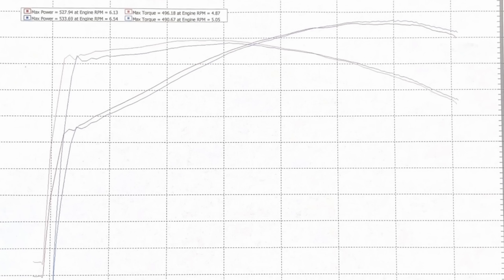Two quick pulls — huge thank you to Billy and the guys over here at Anderson Performance East, they literally squeezed us in to get this thing on the dyno. All we needed was two pulls: one with the cutouts closed and one with the cutouts open. We picked up roughly six horsepower, so kind of cool to see that the cutouts actually do something. Now, is six horsepower worth having the cutouts? Me personally, I love the way it sounds with the cutouts closed — I'm never driving this thing around with the cutouts open. Now that we know how much power this thing makes, the last thing we need to do is go over the numbers for this car.